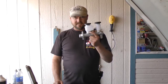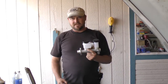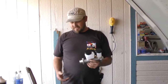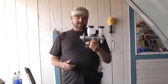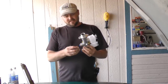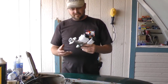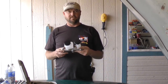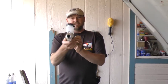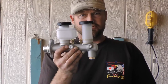This is Mad Matt from Budget Boosting. Today I'm going to talk about changing the brake master cylinder. Master cylinders are a little bit different on every car, but the concept is pretty much the same: removing the old master cylinder, pre-lubing it with a little bit of fluid, loosening the lines going to your front and rear brakes, and basically reversing the process for installation. This is the brand new brake master cylinder for a 1974 Nissan Datsun 260Z.